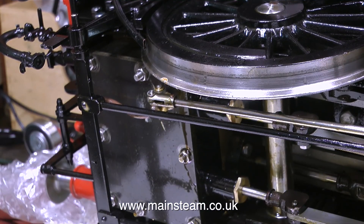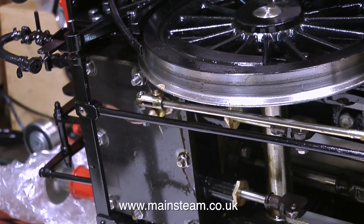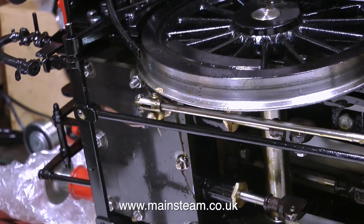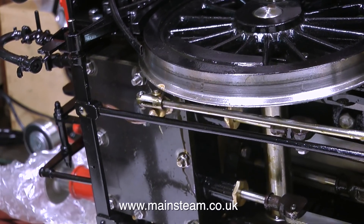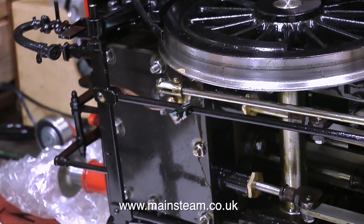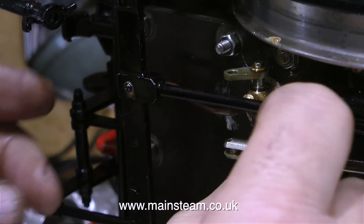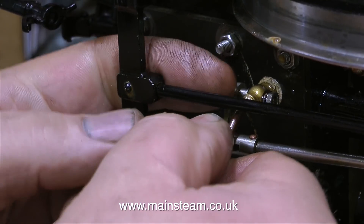From the top of the engine to the bottom. This thing is supposed to be a drain cock — just look at it, it's wobbling about and it doesn't do anything. I would describe this as a piece of engineering excrement. Believe it or not, it's actually quite well made, but it doesn't work. The hole's too small in the middle and it's not in the right position. So the first thing I did was discard the pin that goes through with a circlip — I'm not having any circlips on this engine at all.